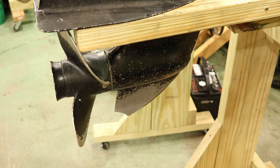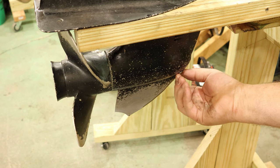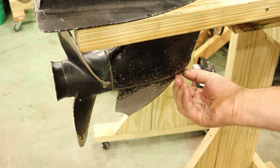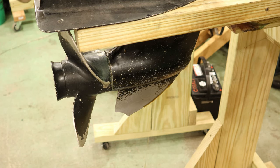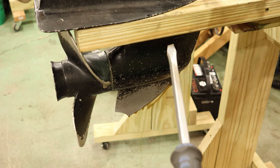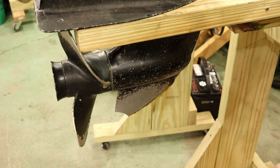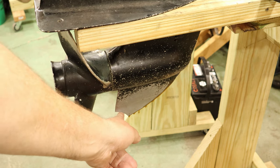Well, let's see if this gearbox is holding any secrets back from me that it's refusing to tell me about. Hopefully all we get out of here is just oil. Good, clear oil. That's some thick stuff. But it's just gear oil, that's it. That's what we like to see, just good clear gear oil. Perfect. Now we're going to pay attention to this little guy right here.